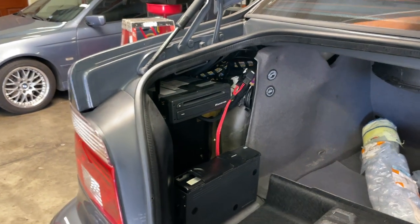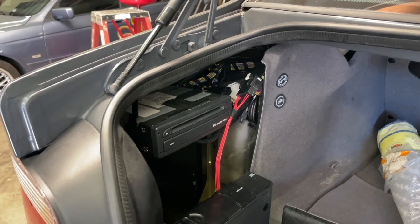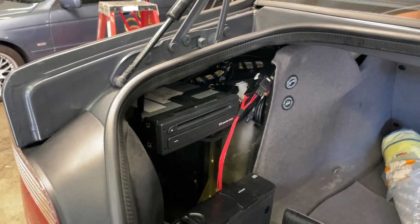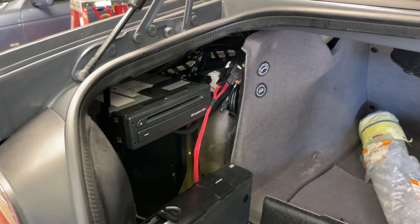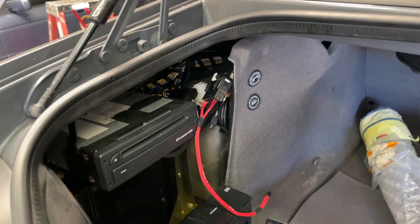So why do we need this cable — what is it for? The Blue Bus actually works fine without it; you're going to get your Bluetooth audio and your iBus integration and all of that will be fine. But if you want to use your car as a phone booth at all — hands-free audio, use the steering wheel to answer a call, and the headliner built-in microphone to communicate with the person on the call — you need this cable to attach the Blue Bus to that headliner microphone and the other electronics in the car to make all of this possible.